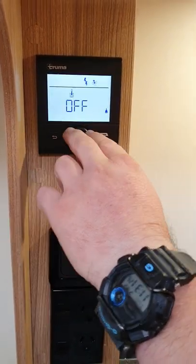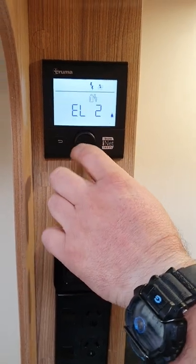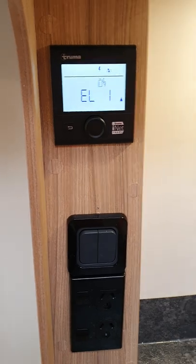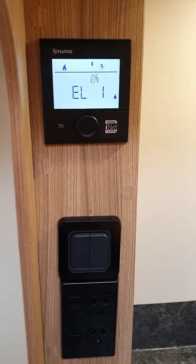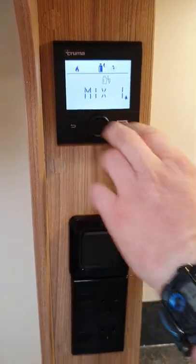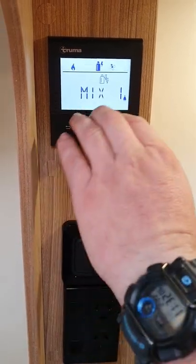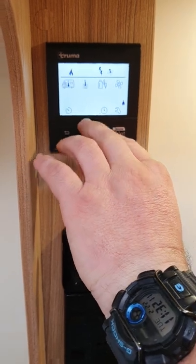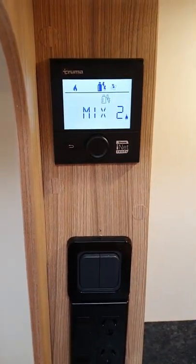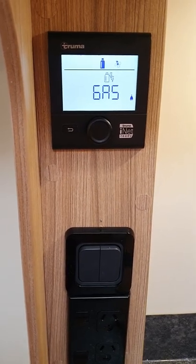Beside that, this is your power input. You're currently on electrical two and you have electrical one — that's purely just one kilowatt of power or two kilowatt of power, so it's just how much power you're feeding into the unit and how fast it's going to heat things up. Going back, you have mix two and mix one. You can have it on those and the system will work out what's better to run on — gas or electric. Mix one is a more gas dominant selection and mix two is a more electrical dominant system, so it'll flick between the two and work out what's more efficient to run on each one. And you also have just purely your gas function as well, so that'll run your water heater and things on gas. Let's go back to mix two.